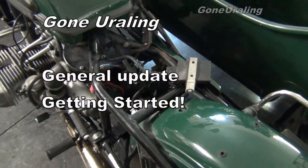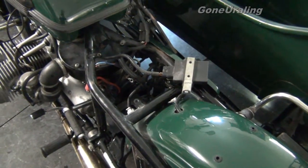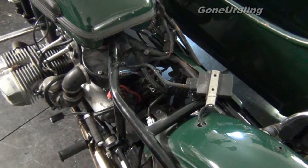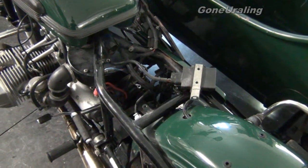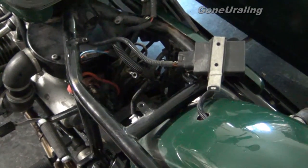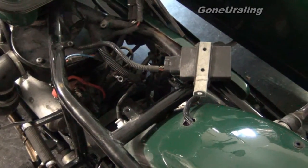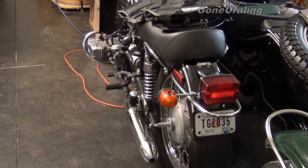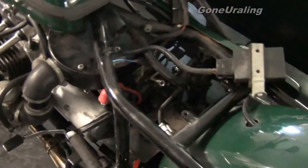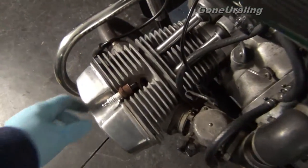We're here to put out a battery — the one in it was a 200 CCA, a little small and old, giving us only about 10 volts, so that wasn't good. We're putting in a 310 CCA battery. I like how this 2010 is set up compared to my 2008 — there's a plate you can take off and just lift the battery right out, no mess, no fuss. On the other one it feels like you're disassembling the whole bike.